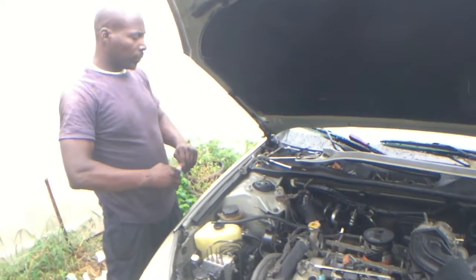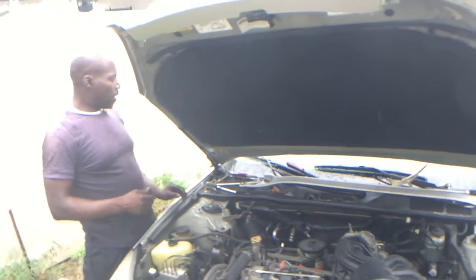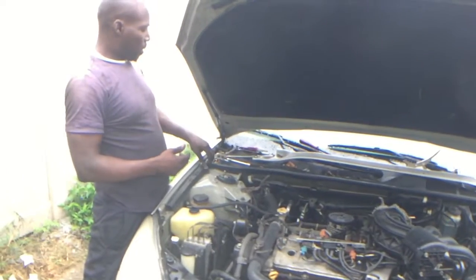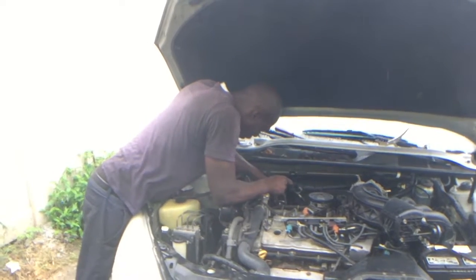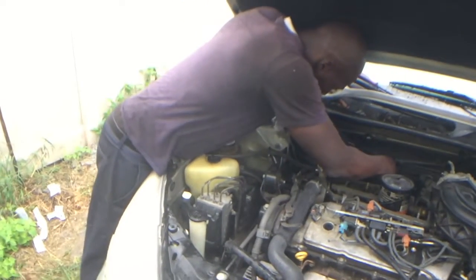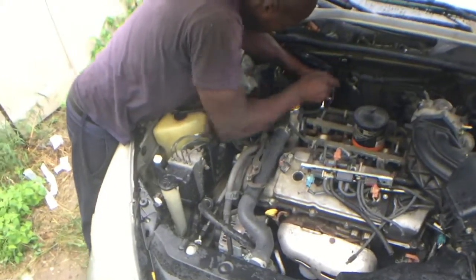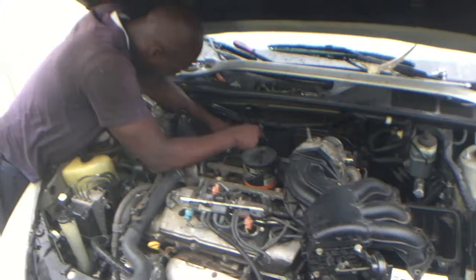In there nice and tight. Okay. But this is to prevent a leak, basically. Yeah, I just removed it. So in replacing it, being that I don't have any Loctite to replace it, utilizing the high temperature silicone to do the job of the Loctite. So this way to have a good seal, which is always a good idea when you're talking about compression, vacuum. Have good seals, no lines leaking.